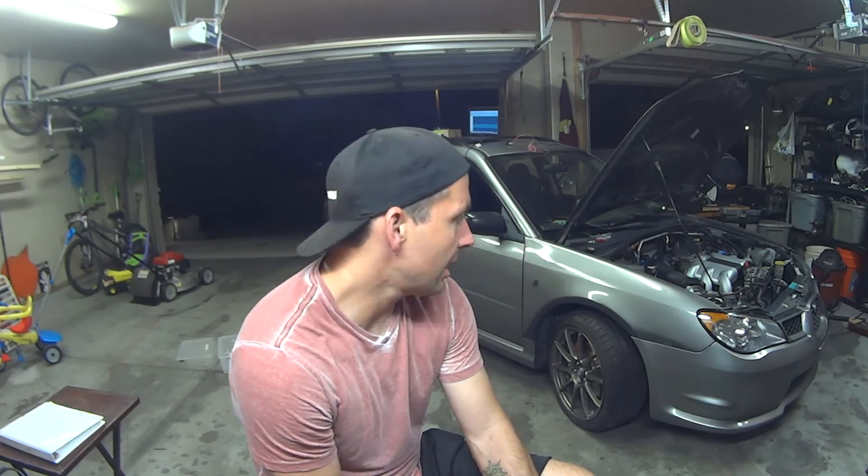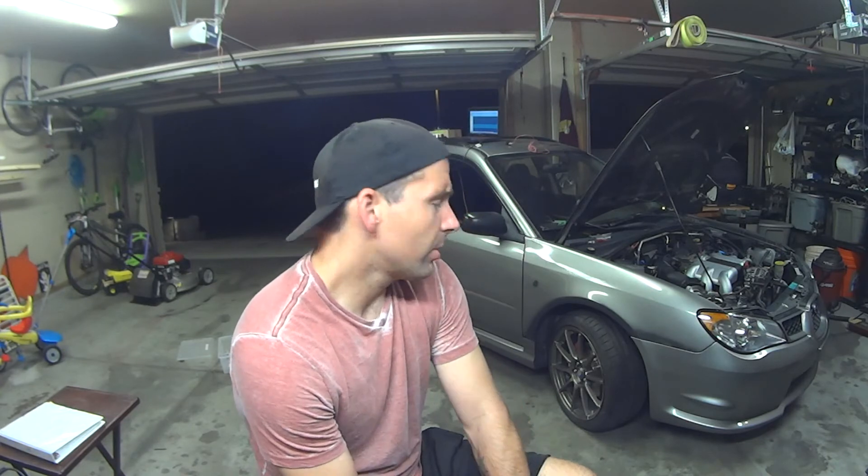The next thing I've got to do is deal with the idle air control valve. The one that comes on the SVX is kind of weird — it's pulse-width modulated but it's a push-pull type system, and I don't exactly have all the electronics to wire that up. I'd require one of my friends to help with that since I'm not comfortable with it. The other plan could be to use some sort of GM idle air control valve, since I currently have the PWM circuitry wired up in the ECU and it might be worth trying to integrate a plug-and-play controller. We'll see what direction I go.